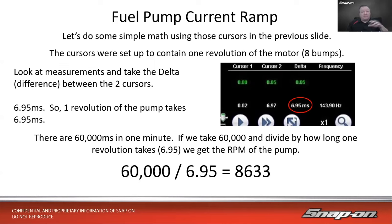When a fuel pump is running well, it should be 5,000 to 6,000 RPM or more — this example showed 8,600 RPM at idle. When you get down to 3,000 RPM or less, that's where you'll start having that fuel delivery volume problem. One car I recall was fine around town but fell on its face under load — it turned out the fuel pump was only turning at about 1,400 RPM, barely providing enough fuel. Really worth looking at, and the current ramp test is easy to do.